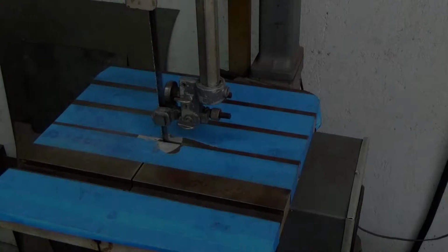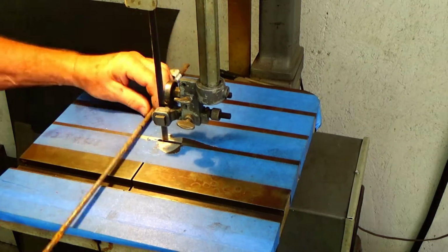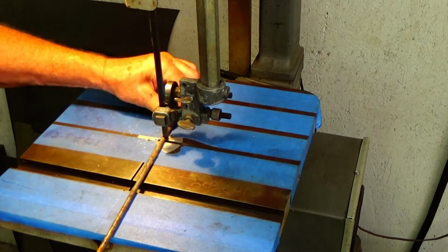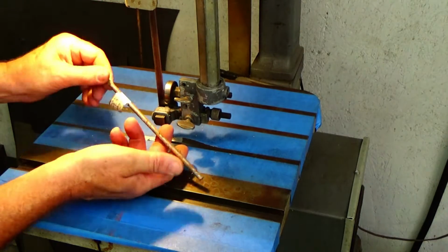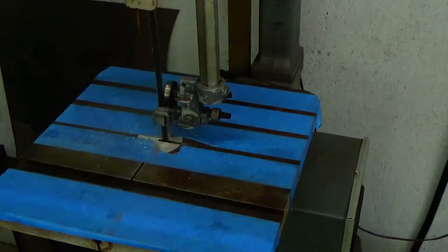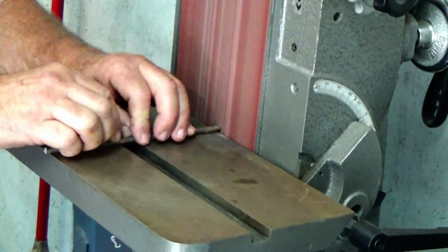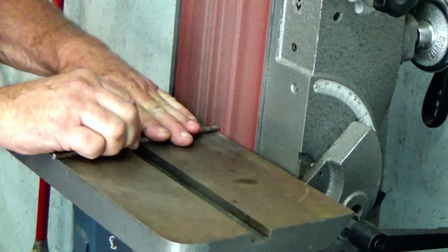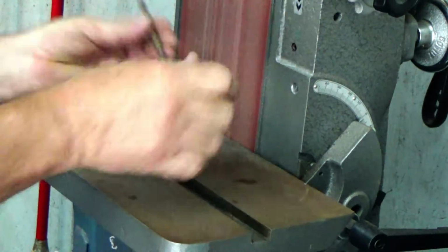So there's some quarter inch rod I had laying around in the shop. And we're gonna cut that into about a seven inch piece on the old bandsaw over here. Now, I have made these little flapper wheels even with quarter inch bolts, like a long shank bolt that may be 5 inches long, 4 inches long, and then you just use the hacksaw to put the slot in it. But since I had this quarter inch rod laying around, we're just gonna make it out of that.